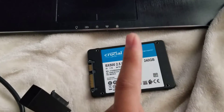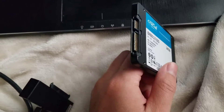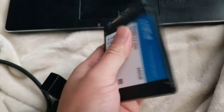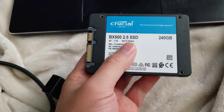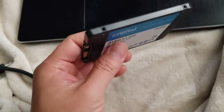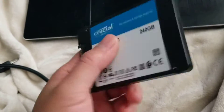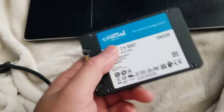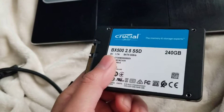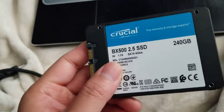There's this type of SSD which is a SATA 2.5 inch. Desktops will use the same — they don't have a 3.5 inch SATA SSD, but they do have adapters just to make it fit if you want to mount it properly. But usually since it's SSD, it doesn't matter if it shakes around, and in desktops you're not really moving it around, so depending on how the case is designed, a lot of times I just leave it hanging with the connectors holding it and it's fine.